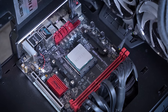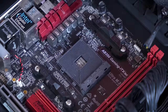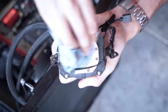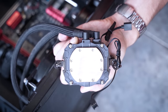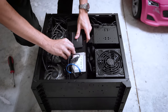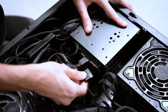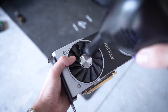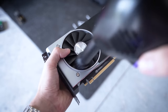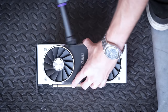I removed some thermal paste and very carefully lifted the chip from the socket. I also cleaned off the thermal paste from the underside of the AIO — I want it to be clean when we give it back. Next, it was time to remove the storage drives. There are a whopping four in this rig: three 2.5-inch SSDs and a single 3.5-inch hard disk drive. Disconnect power and data, slide that out, and then move on to cleaning — starting first with the graphics card. I spent the most amount of time blasting it with my electric duster.